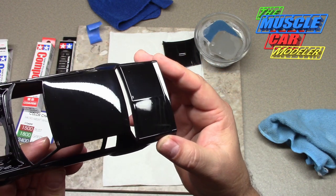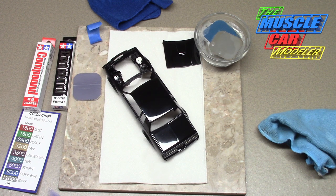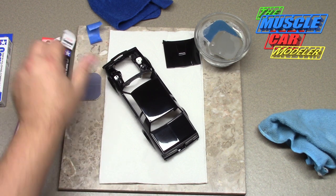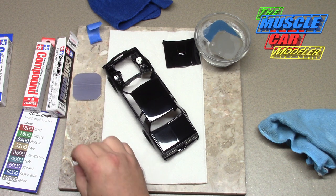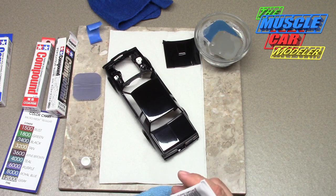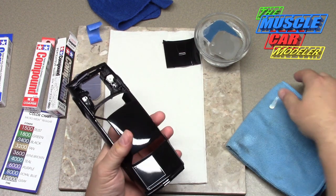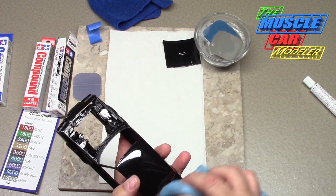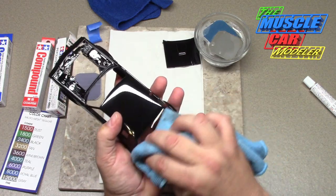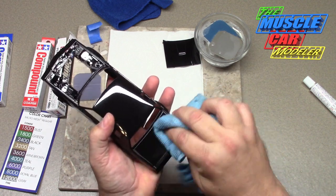She's starting to look really good. I did this to the trunk and roof of that '69 Yenko Chevelle too, because I had some boogers in the trunk of that one as well, and a couple on the roof — so this is exactly what I did, same steps. Black shows everything — it's really hard to polish black because it seems like no matter what you do, you'll get fine scratches in it even from the microfiber towels and polishing compounds. Then you can wax it to get them to go away.